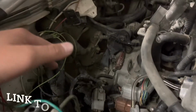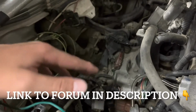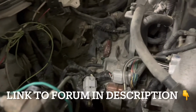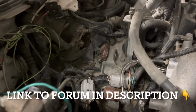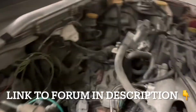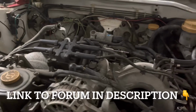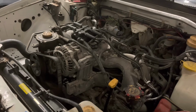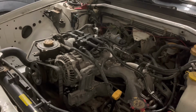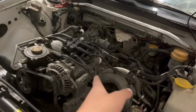So after doing some research online, I found a forum that discussed a 95 GC. What happened was the wires in his engine bay weren't connected all the way, and he was having similar issues where the fuel pump also wasn't turning on when the car was on. It was actually turning on when the car was off, just like ours. So if you guys have that problem where the fuel pump turns on when the car is off, I would double check and see if any of your wires are either disconnected or just loosely plugged in.